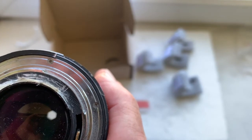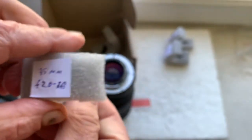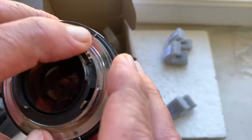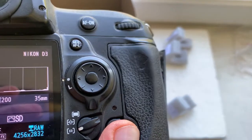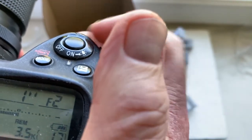Degrease all surfaces and install a little super glue gel with help of a toothpick on the place where you install the chip. Then install the chip on the glue. Chip number two, chip number three. This chip is pre-programmed — focal length is 35 mm, aperture range from 2 to 16, and focus track mode on all chips is on. The chip number three.